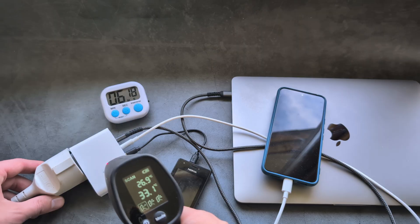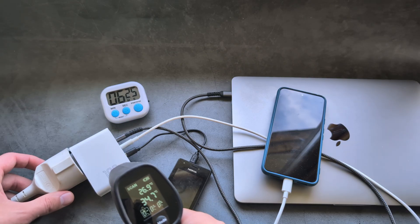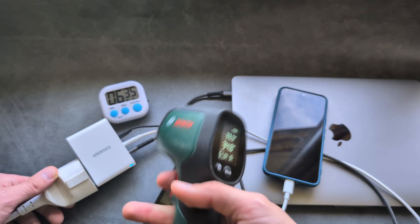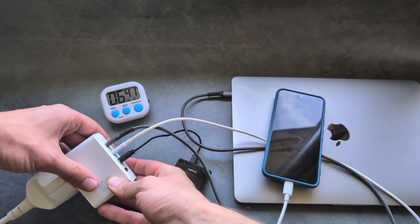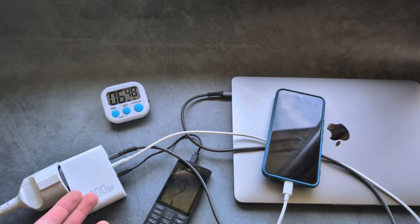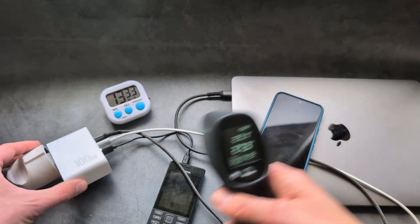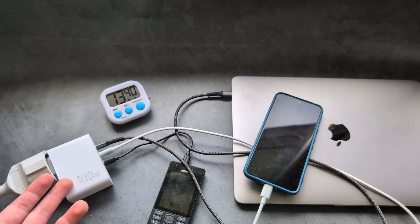Indoors it's literally 27°C inside, which is very hot. The charger surface reads 34°C on one side and around 35°C on the other — so only about 8 degrees above ambient after six minutes of charging. When you touch the charger it doesn't even feel warm. At 13 minutes it's still at 34.6°C — the thermal performance is excellent.